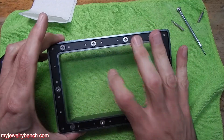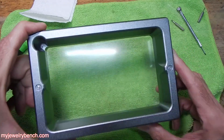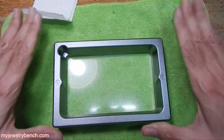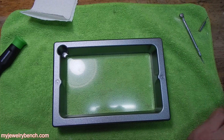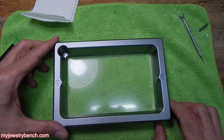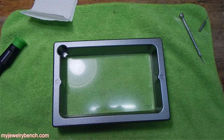There we have our new FEP film. Tap on it — it should sound like a nice drum beat. It should be tight and firm. A good way to test this is to fill it up with some warm water, let it sit, and see if it leaks somewhere. Hopefully if you did this right, you won't have any problems at all. I hope you found this helpful — if you did, please give it a thumbs up, and if you're not a subscriber, consider subscribing. If you're looking for information on FEP film or good printers right now — this is Christmas Eve 2020 — go to my blog site, click the link below. It'll take you to the page on how to do the FEP film change, and I'll also have links to some really wonderful products. Have a great day and a great holiday season. Thanks.